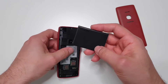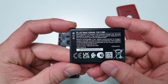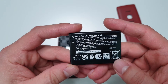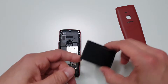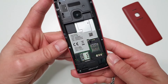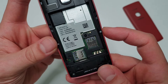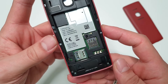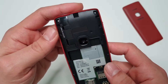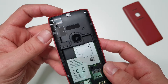Let's get this baby open. This is the original Nokia battery - you can see the number over here: BLL4E, almost 1500mAh. I'm going to leave it to the side. Let's have a look at the inside of the phone. I'm very happy that it has two SIM slots this time around - usually in the UK we've got only one SIM slot, and in Asia they've got two, but this time they did a good job.